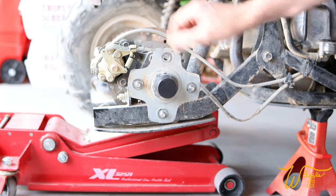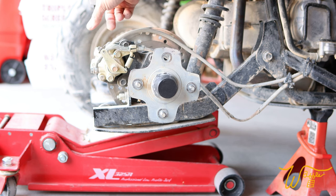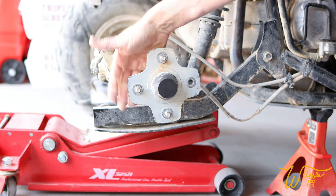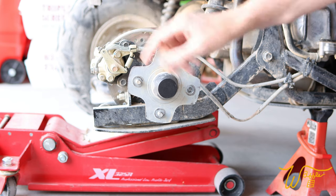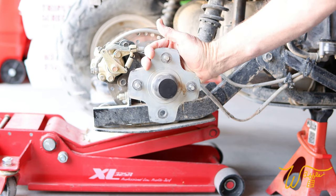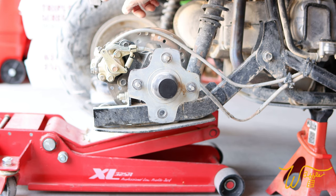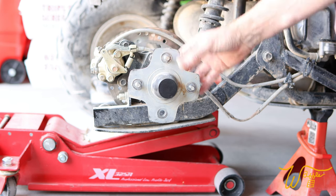Once the wheel's off, you can see the hub here. I like to take the jack and elevate the other tire so that this moves freely. Also, keep the emergency brake off — the reason is I want to be able to move it to the right spot to get a tool on there to remove these guys. If it was locked in place with the parking brake or the other tire set down, you're working around angles that might not be comfortable.